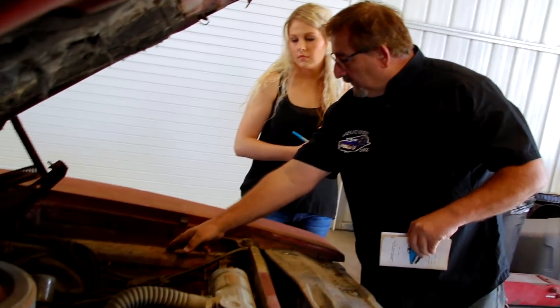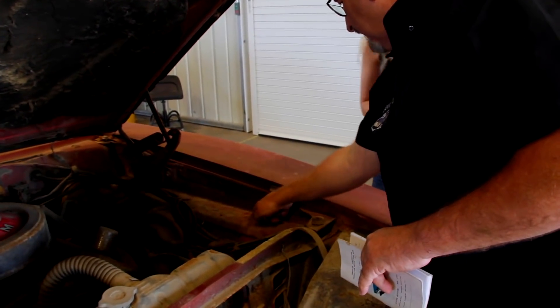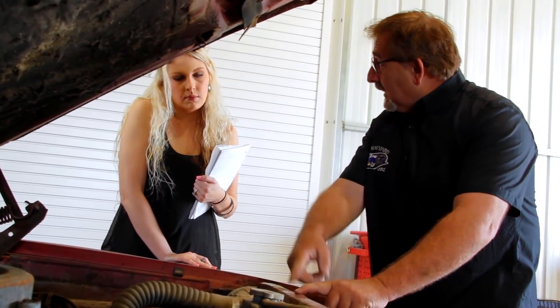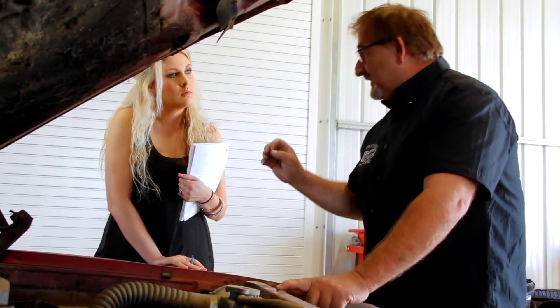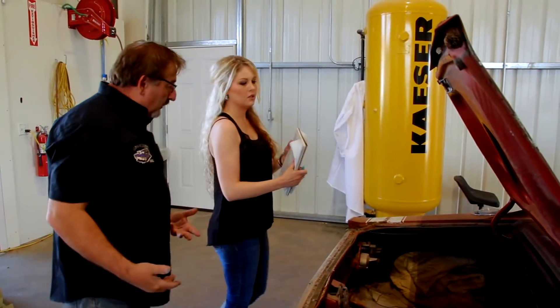In 1969, the full VIN was on the fender tag — it matched the windshield, the trunk lip in the back, and the radiator support. In 1968, they used the shipping order numbers on the radiator support and the trunk lip. The shipping order number is right here on the VIN tag — the last series of numbers: 0, 7, 7, 8, 3, 4. So these two belong together. The question is, did somebody take this radiator support out of another car and weld it in here to make it look like an RT? My guess is absolutely not — it's an original owner car, and you don't see a shiny core support around an old muddy car.